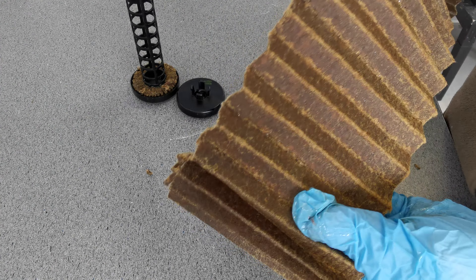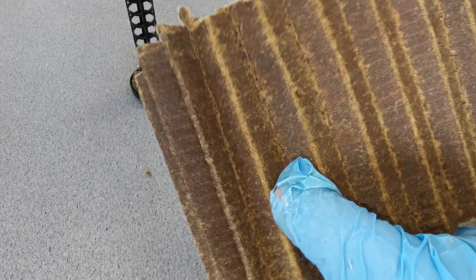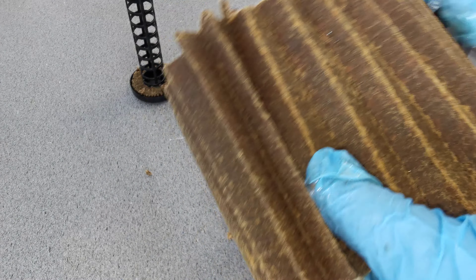But the engine's not dirty — she's quite regular on her oil changes. There's quite a few metal specks in there. I hate those dry starts on the 3.6s, it's terrible. But clean filter — always uses synthetic, and it's clean. Not much gunk in here. Oil change was done at 5,250 kilometers. But I can't believe how much metal's in here. Do all Jeep engines do this? This is terrible.